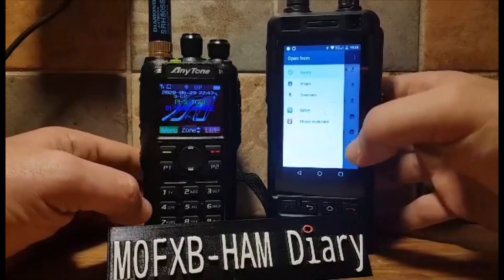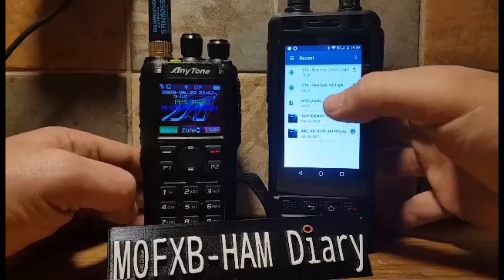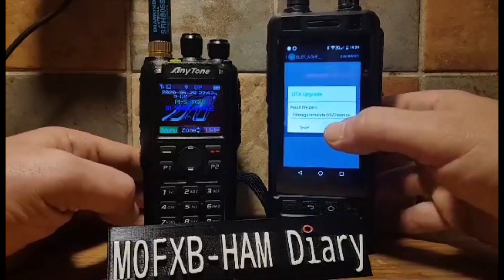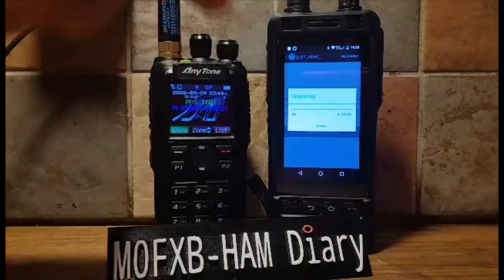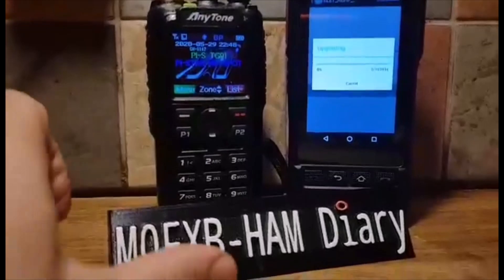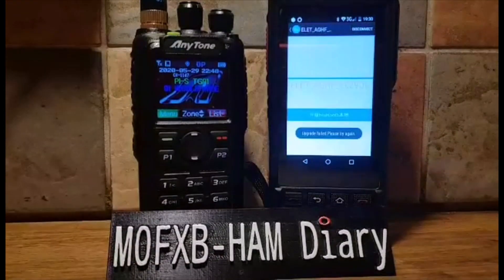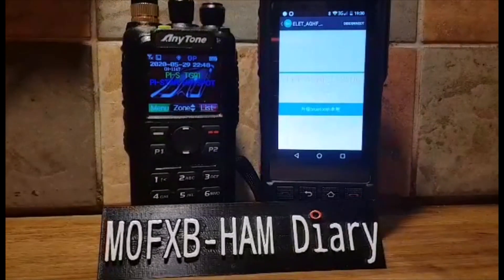Back out of that and choose the B707 audio bin — that's your firmware — and then here it says upgrade, click upgrade. Now it's going to upgrade — these are talking to each other now. It was quite quick. Now it's failed — do you know why? It's failed because I've already done it. But it takes about three or four minutes, and at the end of that it's upgraded your Bluetooth firmware.